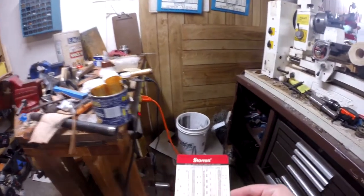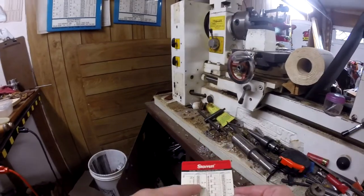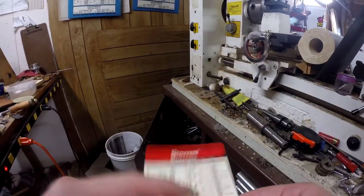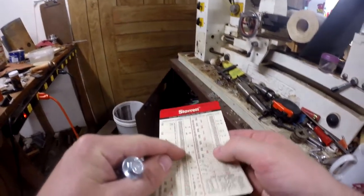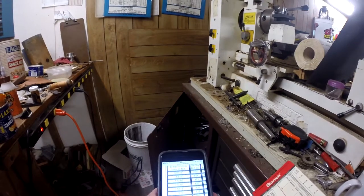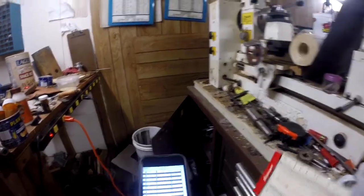But that doesn't stop me from drilling the hole. Next we need to find out exactly what size hole to drill, because you don't want to drill a 5/16ths hole, otherwise you won't have any threads. One neat little tool is these drill charts — I'll put a link in the description. For 5/16ths, you can see the decimal equivalent and it gives you the tap size. For a 5/16ths tap, I need a 17/64ths drill bit. I'm going to verify that with a search engine. This better chart I found online confirms: drill 5/16ths — 17/64ths. The decimal equivalent is about a quarter, so I could get away with a quarter if I need to.